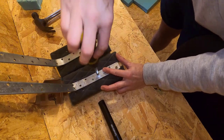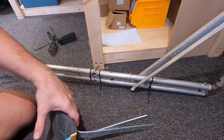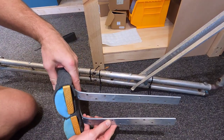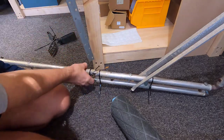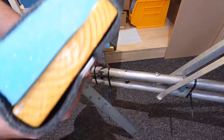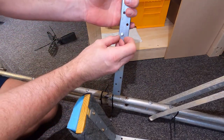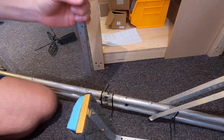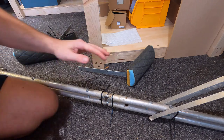It's got a slight twist in it but I think they're going to be okay. I'm going to try and fit them to the trailer now. I've just cut these to size so they're the same length and tidied them up with the Dremel just to stop them being too sharp. Then these are going to go on here, roughly like that. I've actually found some M6 bolts that will slot through there — that's really useful. Let's get this jacked up and get these screwed together.